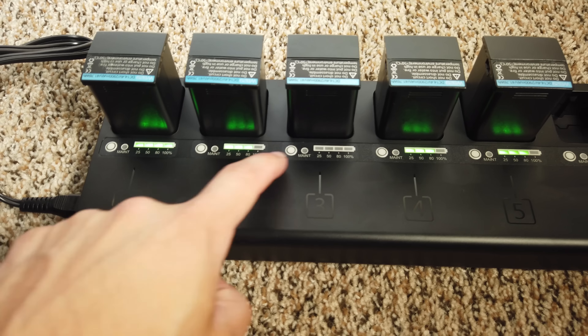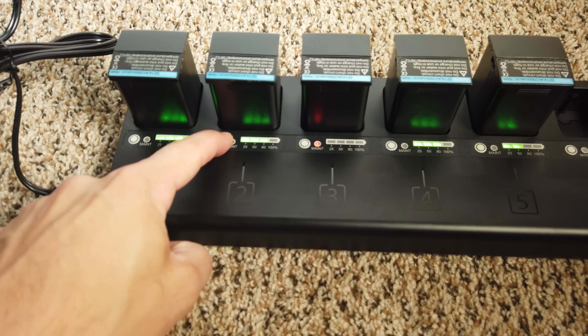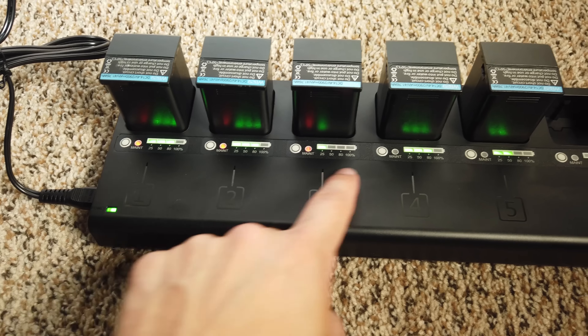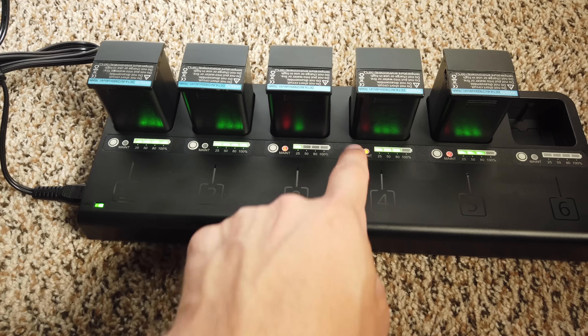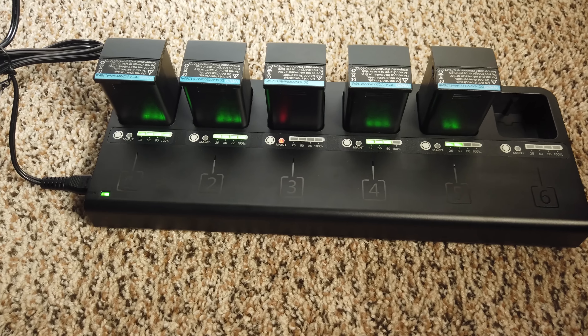It's not just when using the device — you can also overcharge these batteries simply by leaving them on the charger too long, because the standard charger will keep sending power to the battery even if it's full. A nice perk to this six-bay charger is that it comes with a maintenance mode. The maintenance mode will automatically stop power to that port once it detects the battery is at 60%, which is a healthy power level for the battery to sit at. So if you're setting these on a charger and forgetting about them, it's far better to do it with maintenance mode on — that way you're not overcharging the battery constantly. When you're ready, you can come back and turn the maintenance mode off and let them charge to 100%.